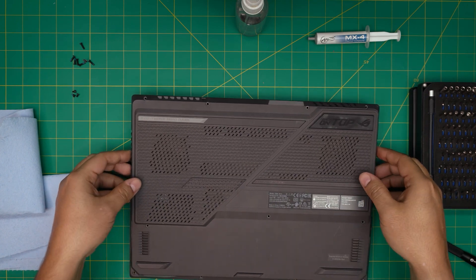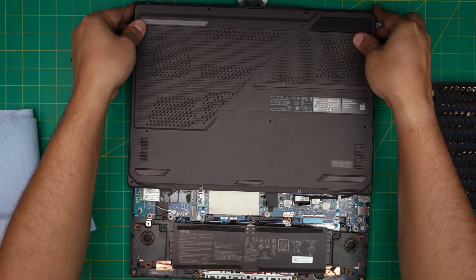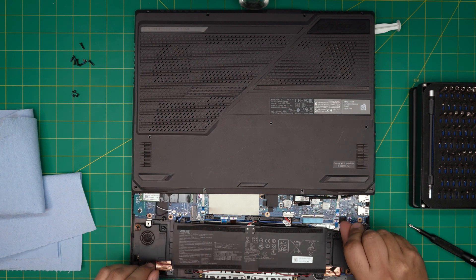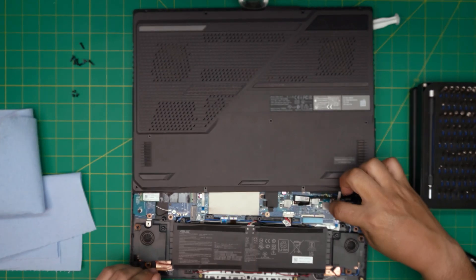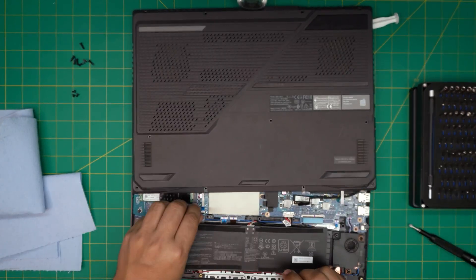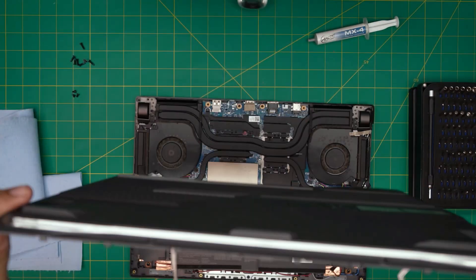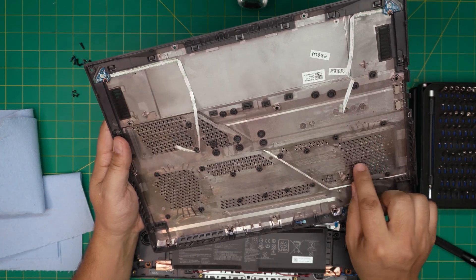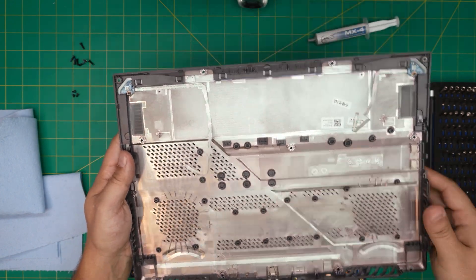Once finished, simply lift the cover — don't yank it, lift from the back side and bring it forward. We're going to disconnect these two flex cables: open up the lock, put your fingernail at the back of the tiny locks, lift the hinge 90 degrees up, and then slide the flex cable forward. Same thing with the second one — these are for the LED lights on the front of the laptop. You can grab a toothbrush and clean up the mesh for air circulation — there's a lot of dirt in there.